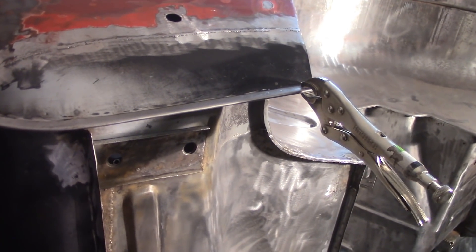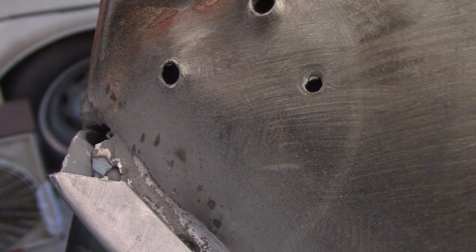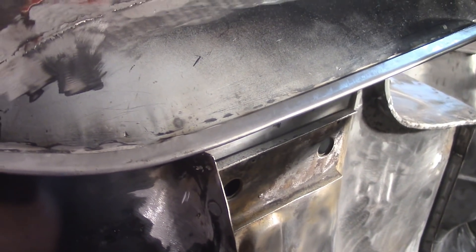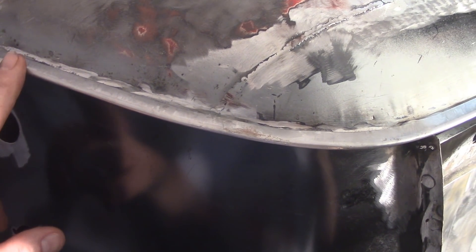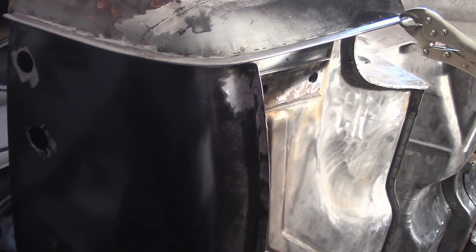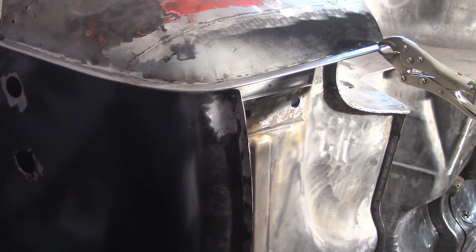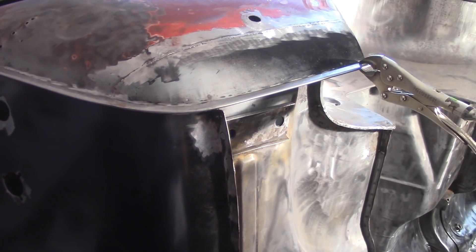Got the car flipped to the other side — much better fit on this one. You can really see how the angle is definitely cut wrong; it should come up like this, so again I'll have to come up with a solution there. Only one clamp is holding it and it's nice and tight. Given that and the fact that it's not structural, I'm just going to do three spot welds: one up at the top, one toward the middle, and one toward the end. This is not a structural piece — it's just a vanity piece — so it'll be easier on the seam sealer side. One side gives you fits and the other fits perfectly.